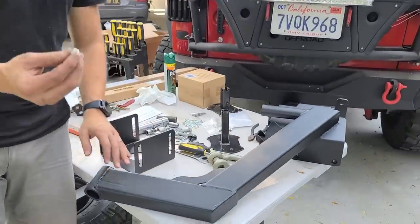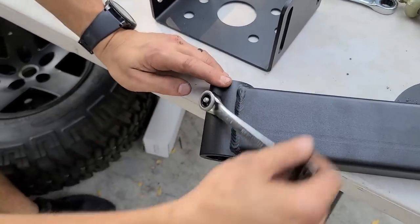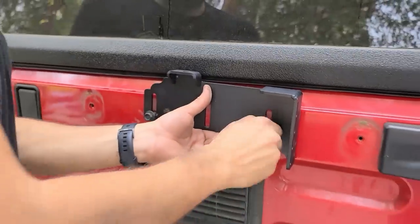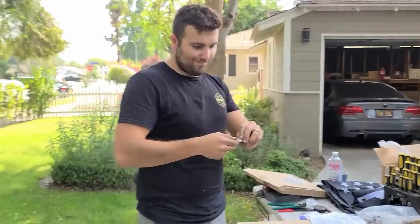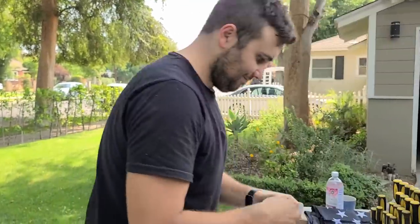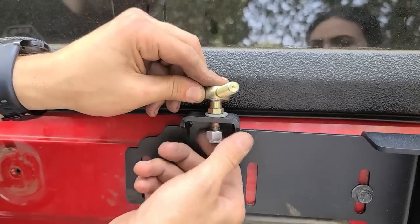Here's the tire carrier swing-out arm. This is a grease fitting — we're going to go ahead and screw this grease fitting in using a 7/16-inch wrench. This is the bracket — going to reuse the bolts that came out and only hand-tighten at this point in time. Time to install this swivel joint. You're going to use a washer through the shorter end, drop it down through this hole, and screw on this hex nut just like so.